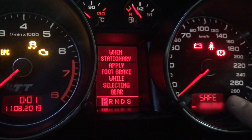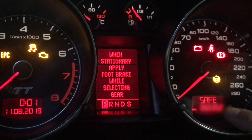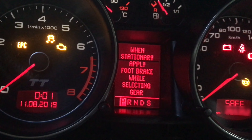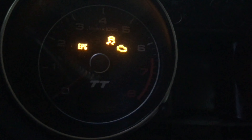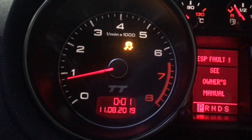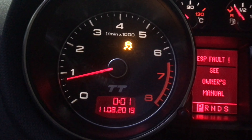That's the one that was installed in the car with a white LCD. This is the red LCD one. You can see there is an earlier revision letter on this one — that's a C. The white LCD cluster is the F. There might be other revisions with different letters, but those are the ones I've got here.